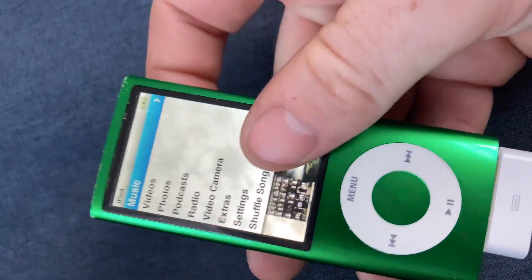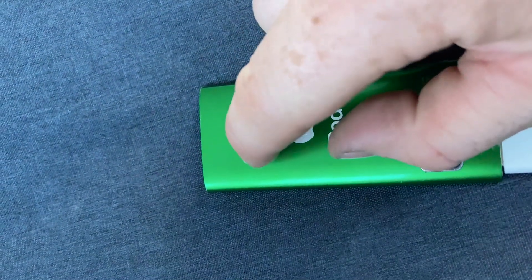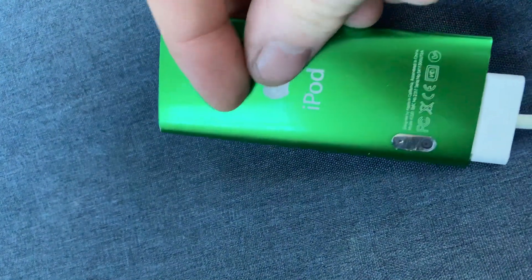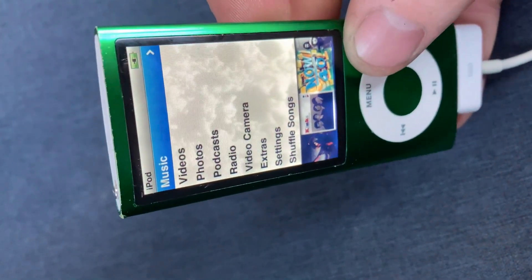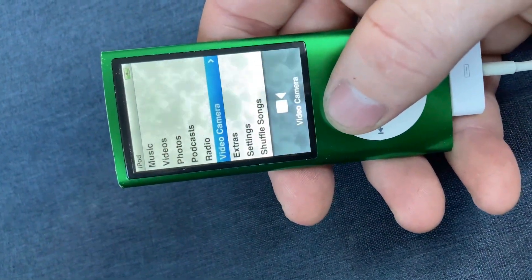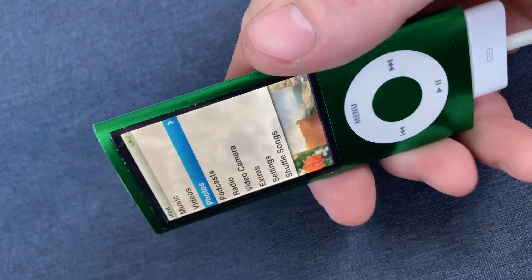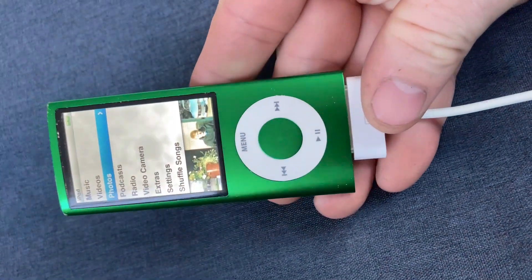In future, or if you ever do this, learn from my mistake. That piece of adhesive that holds in the battery — just poke something down to cut through that adhesive, and you'll probably have more of a chance of saving the hold switch's cable, unlike me. And you won't have to fluff around trying to re-solder jumper wires onto the switch. But anyways, the iPod is working great — battery holds a charge now and the screen's not being pushed out. Very happy. Thanks for watching.